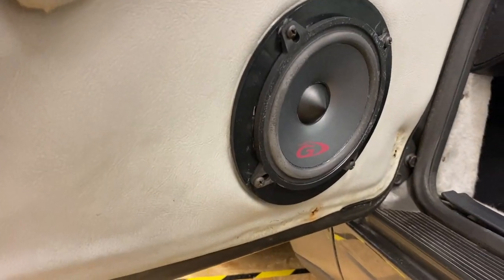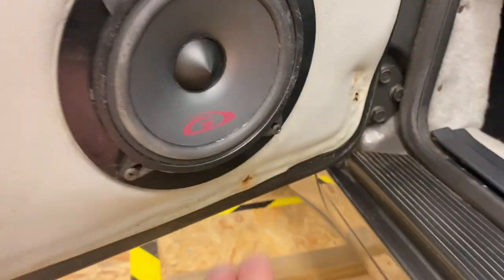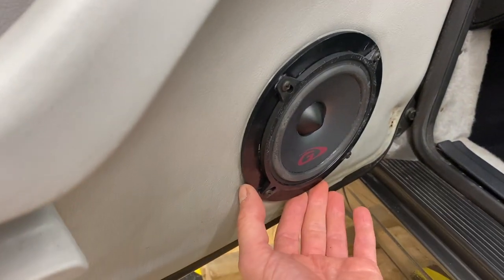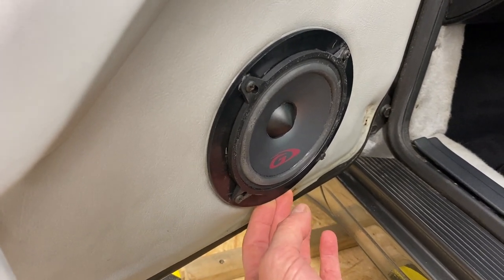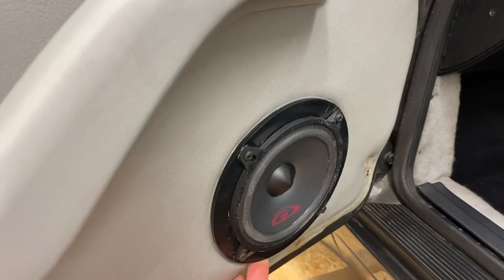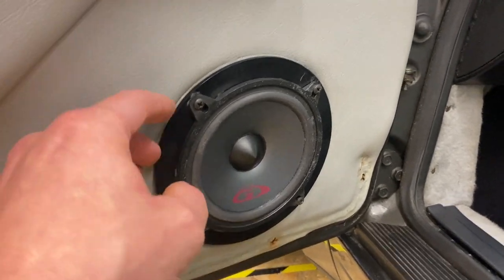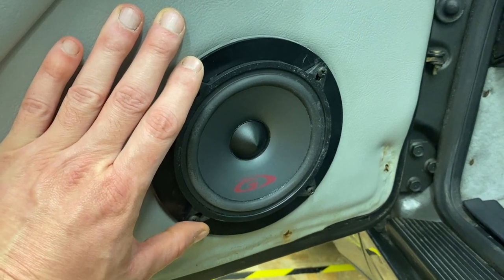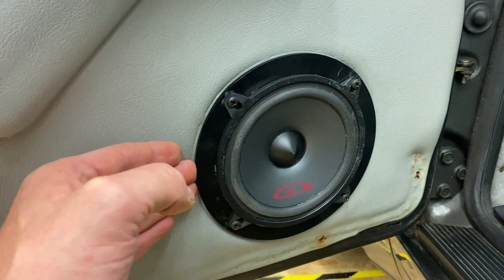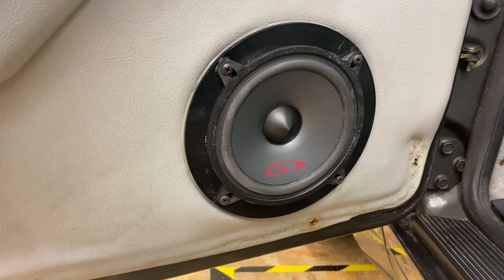If you don't put a speaker in properly it's never going to sound right. On the face of it a five-inch speaker should still perform to a certain degree, but the speaker is basically just screwed to the cardboard door card — at the bottom it's almost just attached to the leather. Any force coming through that speaker is just going to vibrate the door card rather than reproduce sound waves into the car. Not at all the best way to mount a speaker, and it's not surprising we weren't getting much volume from the front — half the energy is lost with the door card moving instead of the cone.